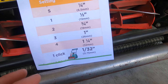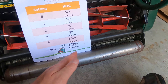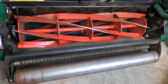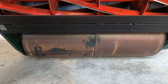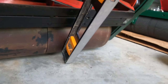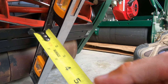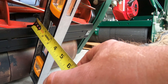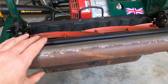Last year I started trying several different things. I even thought about ordering one of those expensive accu gauges like the ones used on greens mowers — where you take a bar on the bottom and a fancy gauge measures the height of cut against the bottom of the bed knife. What I did first was lean my mower back and take a straight edge, like a level, and then take a tape measure. It was reading right at one inch. I was on the verge of ordering one of those fancy accu gauges, but then I realized the front roller actually moves.